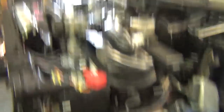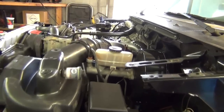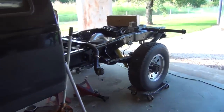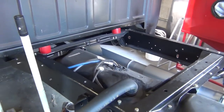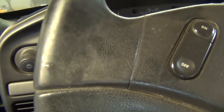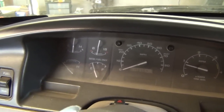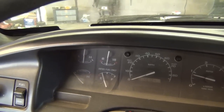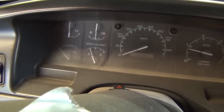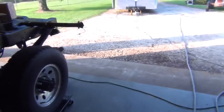That was almost too easy. I swear to you this video is not a fake — I have not started this truck since August of 2010. The fuel system was completely dry; I filled up the canister. Now if it's not sucking fuel out of the tank it will run for a little bit, so we're going to let it run and see what happens. The oil pressure came right up. I was tempted to prime it — I was going to crank it with no computer hooked up because I was a little concerned with that empty oil cooler — but I thought that's no worse than having an empty oil filter. Not good, but they will survive it. Just to see my oil pressure is up. I'm not going to give it any throttle, I just want to let it idle for a while. That is unbelievable how easy this old truck started.